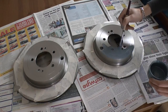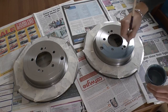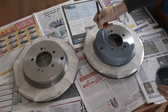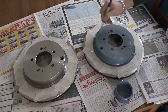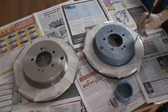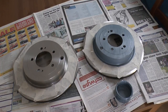This first attempt wasn't too bad, but it did come out a bit too light and too blue, so I made sure for my second coat to mix up a darker batch. There's no special trick to painting with a brush - choose a relatively small one if possible. Make sure to paint on evenly and not too thick. Take your time and work out any brush marks as you paint. The smoother you can make the paint look at this stage, the less sanding work you'll need to do later. Make sure you have good even coverage including painting up and over the masking tape, then leave to dry for at least 24 hours.